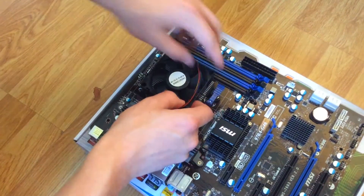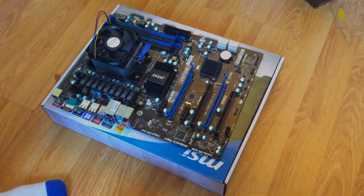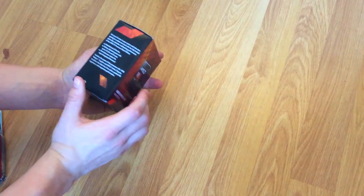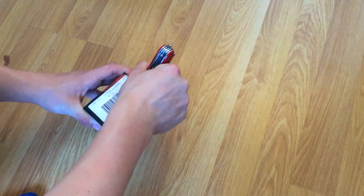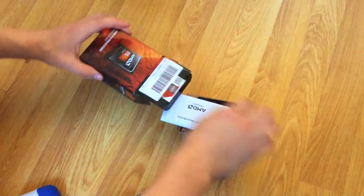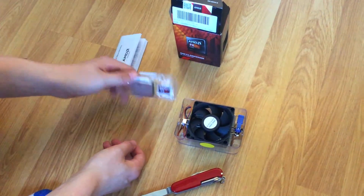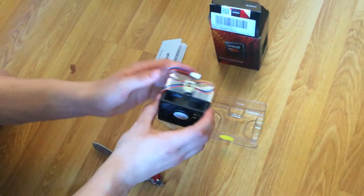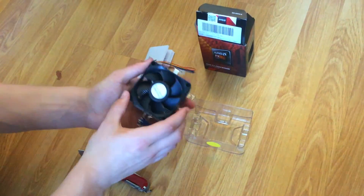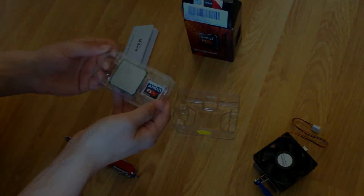That slots straight in there, and that is all there is to it. That is how you install the CPU to your motherboard — all motherboards are similar enough to this one. Be really gentle with the CPU. A lot of people go for this 6 core processor; the AMD FX 6300 is highly used when building a gaming PC. It is clocked at 3.5 GHz but you can overclock it — safe would be 3.8 to 3.9 GHz, and the max is about 4.1 GHz, but I would not go that high. If you have experience overclocking, go for 4.0, but I recommend staying around 3.8 to 3.9 to be safe. I hope you enjoyed the unboxing, review, and motherboard mounting video for the AMD FX 6300. There will be a link in the description to the full PC build playlist. Have an amazing day and I'll catch you in the next video.